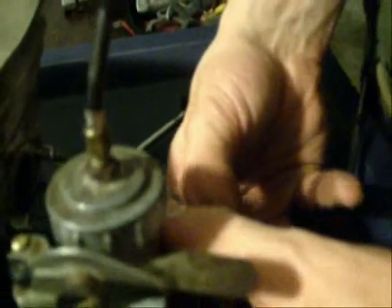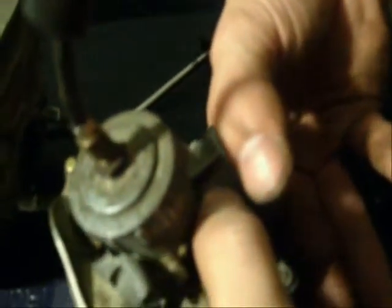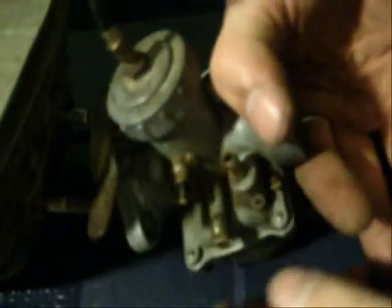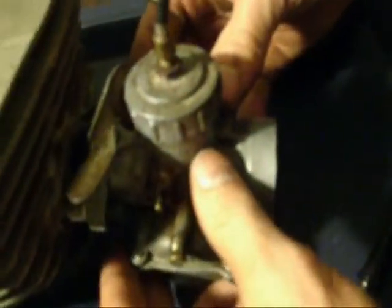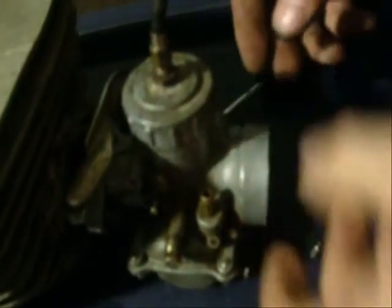I'd show you on a real one, I just don't have one handy. And you're going to put one end in and then force the carburetor around like so, and it'll actually stuff into it, and you're pulling back on it with both hands, and then bring it forward, and it'll mate like this, and that rubber boot will stay on it. Tighten up the boot, tighten up the bolts, you're ready to ride.